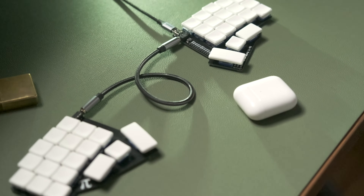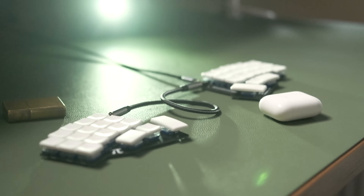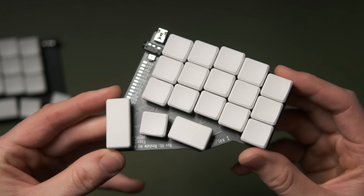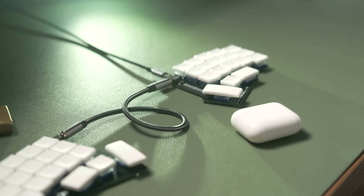In terms of ergonomics, I've always thought thumb keys are the things that make a keyboard work for you or not. The way your hand is rotated has a big impact on where your thumb falls on the inner and outer thumb row keys. When you buy it, there's a 1.5u keycap in the middle and a smaller one on the inside — that seemed the wrong way around to me. Having a longer key at the home thumb position makes it ambiguous where your thumb is, so I switched the 1u key to the home position and used the longer one on the inner key. That brings the outer thumb key closer to home and gives room for overshooting, which is great since the thumb isn't very accurate when stretching.